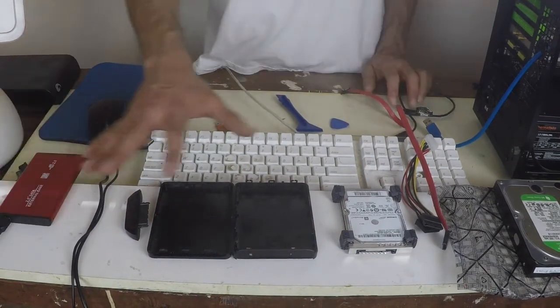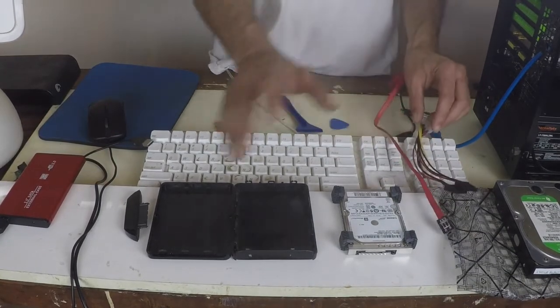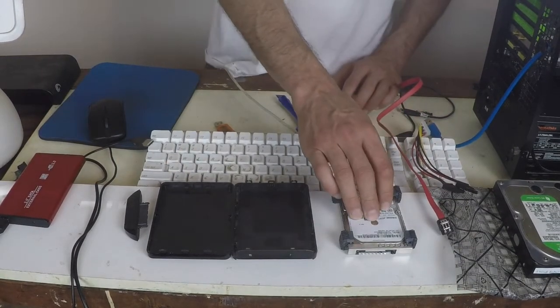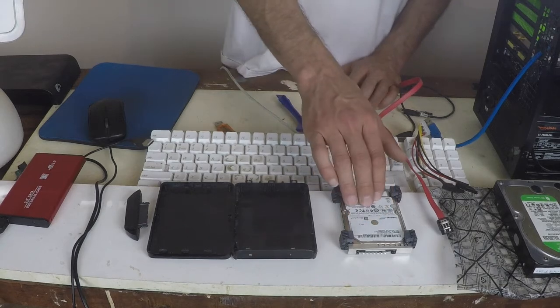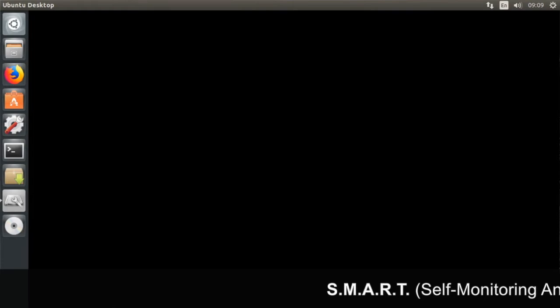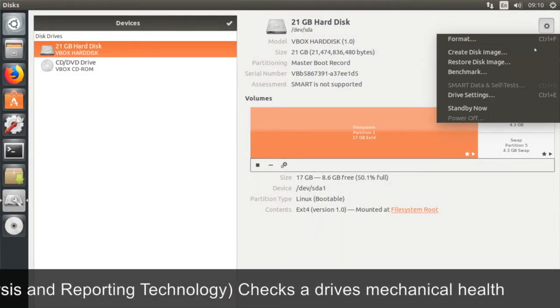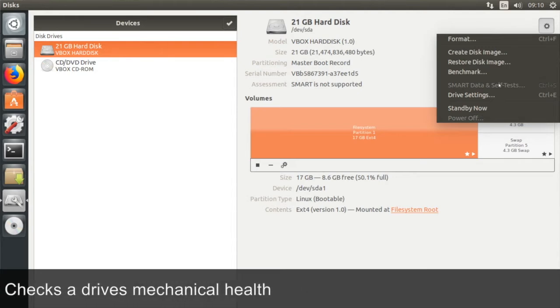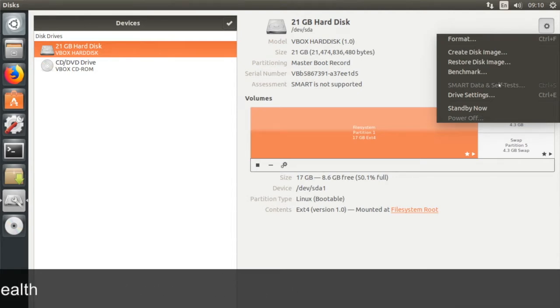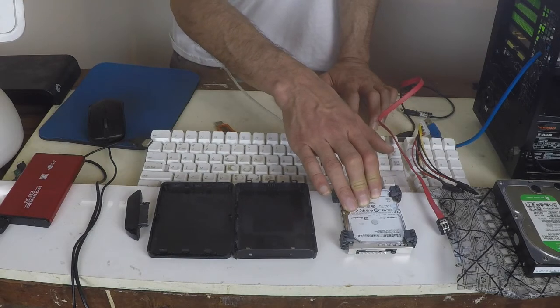If you've actually tried the drive using the SATA cables and you've still been unsuccessful and the drive is still not working, you do need to call a professional. However, if you have gotten the drive working, it's good to conduct a SMART check — that's an option in GParted and it just checks the drive's health. If you have got a damaged drive, you can contact an IT professional — make sure they are certified — ensure they've got a clean room, or you can contact the manufacturer.